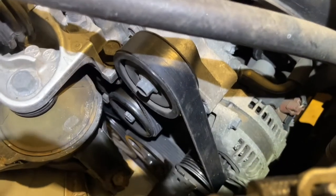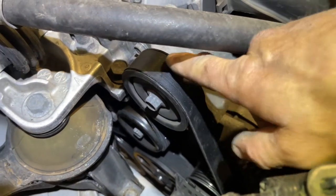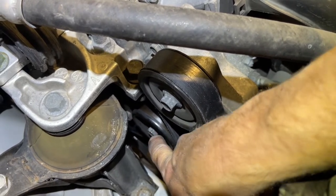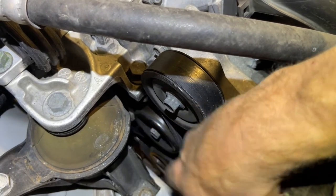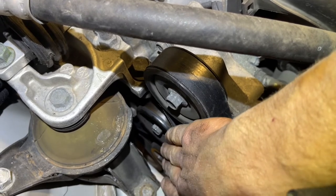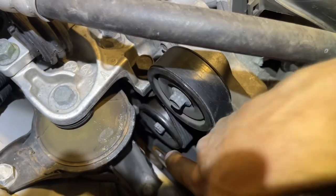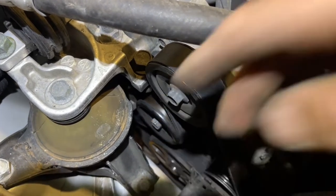I've got it reinstalled — it is a tight fit and you're probably going to have to fight with it a little bit. What I wound up doing is routing it over the idler, then I stuck the socket in and had the belt around the outside of the socket. Then I took the tension off the tensioner and was able to slide it over, because this pulley is smooth — it's a little easier to slide a tight belt over a smooth pulley versus the ribbed one with the lip on the edge that needs a little more slack. That was the last pulley — took the tension off it, slipped the belt over, and now we're good.